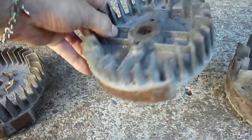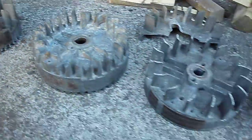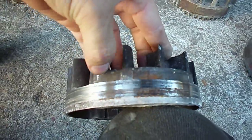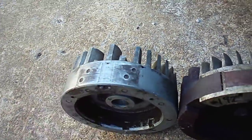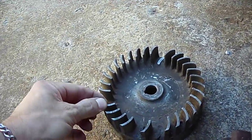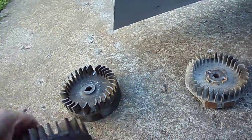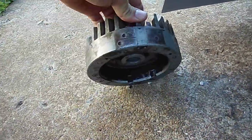As you can see on all these newer guys, that's a single magnet - they're all single magnets. You might think this piece is a magnet, but it isn't - it's a weight. So the first major change was two versus one magnet. The other thing is the material. This old one is some kind of heavy lead-based or zinc-like material - the fins will actually bend a little before they break. It's very heavy, whatever it is - definitely not aluminum. That's for the old cast iron block engines, like a 5S and that type of thing.